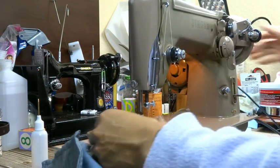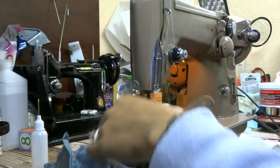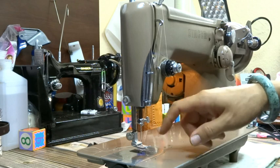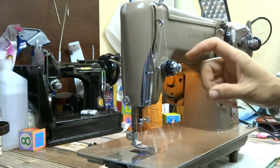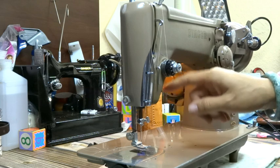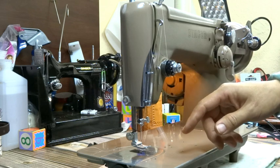It has a low melting point, which is what you would need for a motor setting. Now, this sewing machine is actually supposed to use a special type of bobbin case and a shorter needle, but I have found another bobbin case that works with it, where it will let you use a normal 15 by 1 needle, or you can also modify the original case as well.